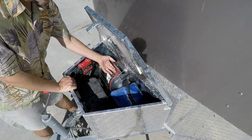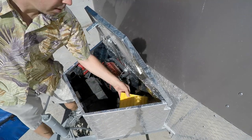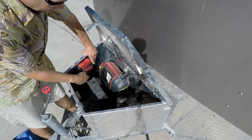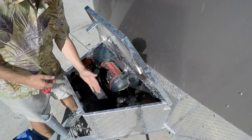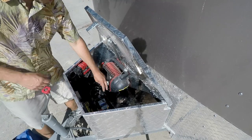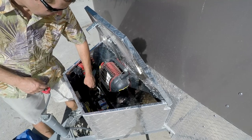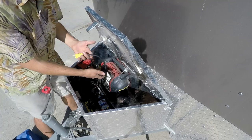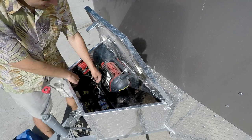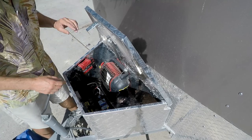I've got that little heater that you've seen in previous videos. I've got my leveling blocks for the trailer in case I'm on rough ground, and I've got some stop blocks here. This is just a charger from Walmart, and I can run the cords out through the side here to charge my battery up. Over here against this side is the solar charge controller. Under here, I've got my battery. The charger is hooked up to the battery directly just with the clips, and then these other wires go out to the different systems. This cord here is my 120 volt cord, and I can run that out the box here and plug my 120 in. And then the 12 volt also runs down along the same cord and into the trailer. You'll see how I did that earlier in the video. So there you go.